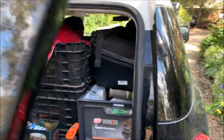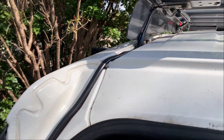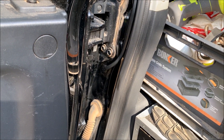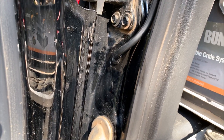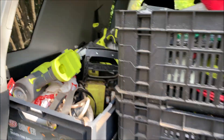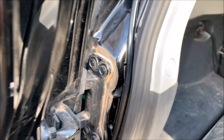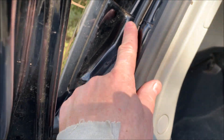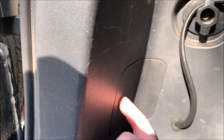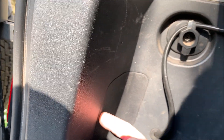I've got a second battery in the back here. Down the back, inside the door, I've put a grommet — drilled the hole through here, put in a grommet, and run it inside. I've just used gorilla tape and double-sided tape for attaching the wire onto the frame, and then drilled from the inside directly through here next to the taillight.